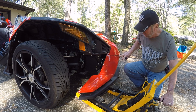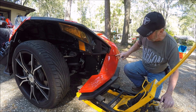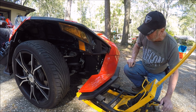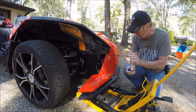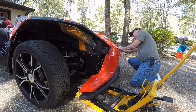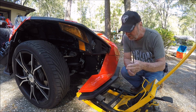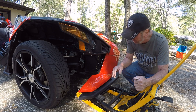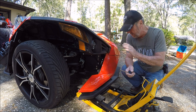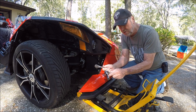There's a bar right up underneath here that supports all of this. I'm going to get my pads up underneath that bar and then simply jack it up. Watch this — here we go. See it moved, and it moved a little more. We have perfect alignment right here. I look on the other side and that side did not come unadjusted, so I don't have an issue with that.